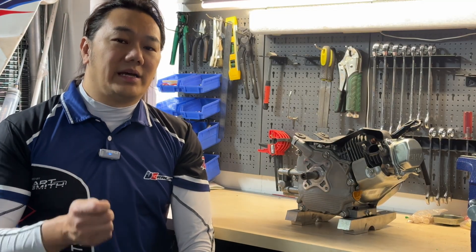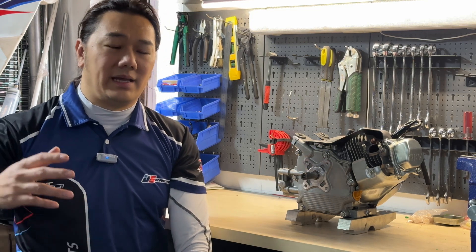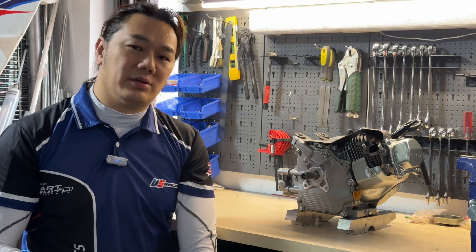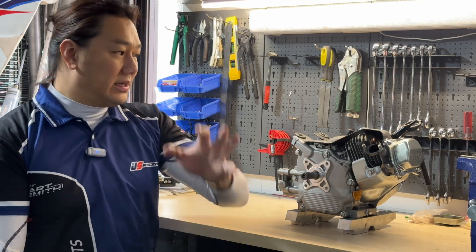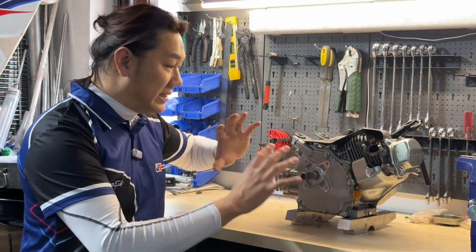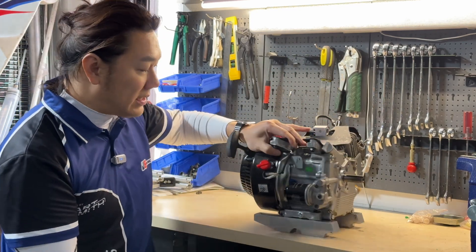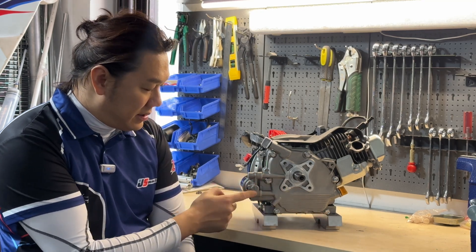The next set of components is really the key and star of this build — all custom-made parts sourced from a factory that specializes in Honda clone and small block engines. These components are built for this specific purpose and you won't see them on generators or lawn mowers. I've installed them on an existing engine to show you what it looks like. The case cover looks the same as any standard cover, but if you turn it this way, you'll find an extra component in the front — an oil filter — with a built-in oil pump inside.